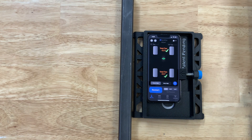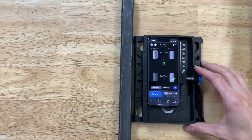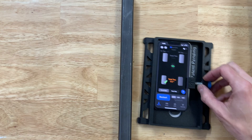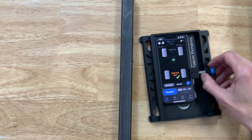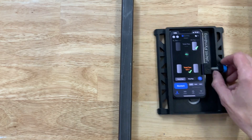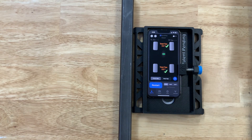Now we're going to do something a little bit more interesting: take a measurement, rotate the system as if it's going to the other side, reference it against the same straight surface, measure the left side, walk back around the car, and measure the right side — also seeing zero toe. So let's walk to the front, measure the right, walk around, measure the left, walk around, measure the right — getting zero toe. I'm going to do 10 runs of this.